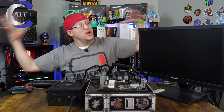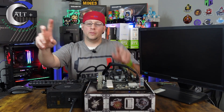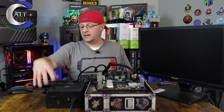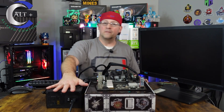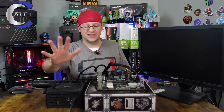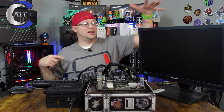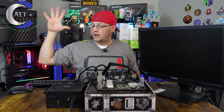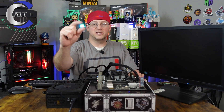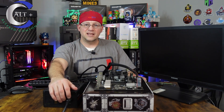We're back and all set up. I took the board and hooked up a power supply — a B-stock EVGA 650 that I bought probably two years ago and never broke the seal on until today, just a bronze cheapo. Sometimes I'll power the rig with just a cheap ATX and then use a server power supply for all the GPUs. I hooked up a monitor using a DVI-D to VGA adapter on a cheap VGA monitor, threw in a keyboard and mouse, and put in a little power switch — you can just use a jumper on the two pins or use a momentary push button toggle that slides right into the power switch header.